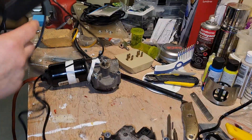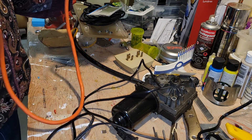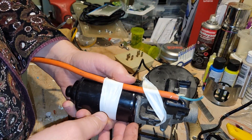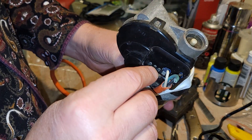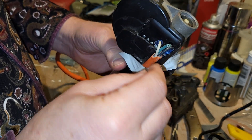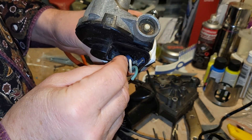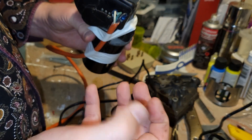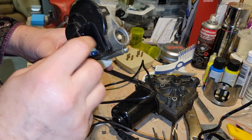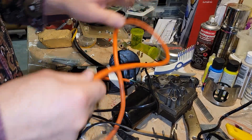Let's get down to it and show you how to do this. I've got two wiper motors here; I'm going to use this one for demonstration. I've hooked up a long wire so the power cord doesn't have to be out in the weather. Down here are the tabs that you hook up to — it takes a little bit of trial and error. For me, the very first tab was the ground wire, and the second one gave me the speed I wanted. The different tabs will give you different speeds, nothing at all, or just a short turn.